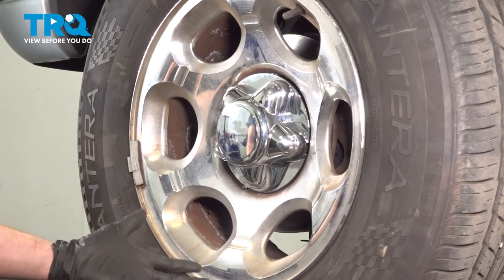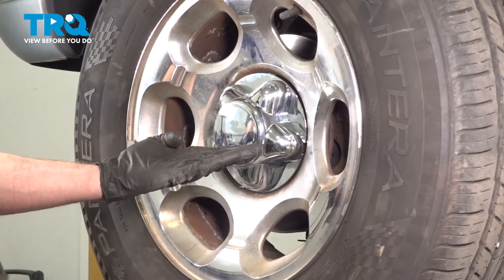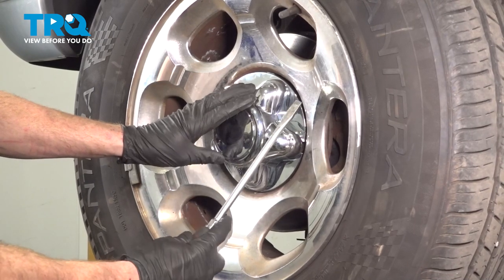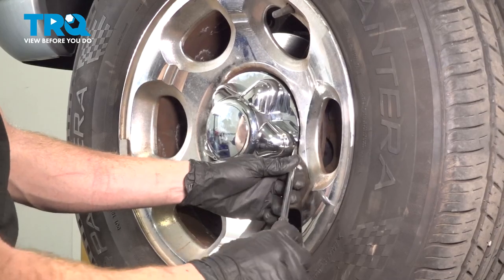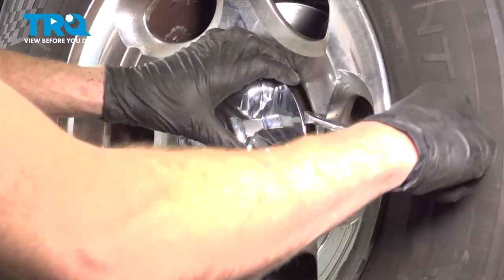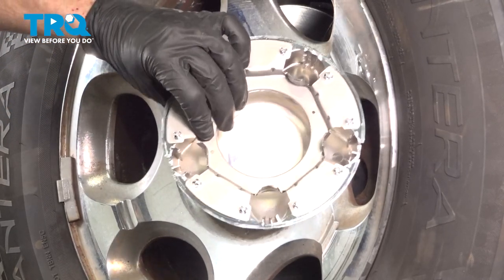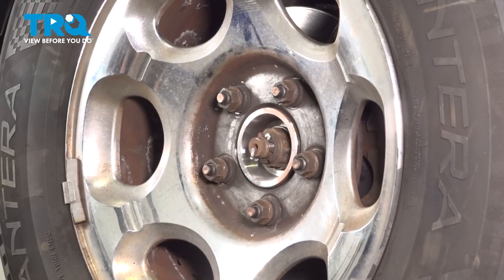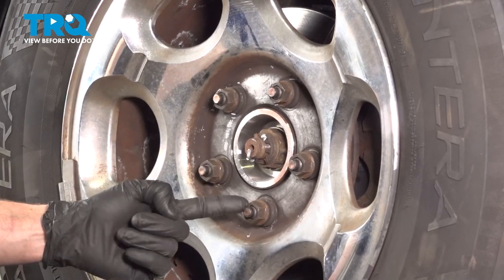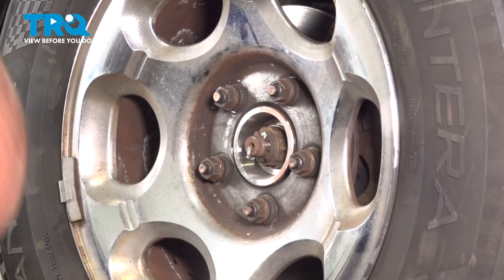The next thing you'll want to do is safely raise and support the front of your vehicle so we can remove the left front wheel. If you have a center cover, you can use a small prying device, carefully get in between this area and separate it. With that out of the way, continue on to your 5 21mm lug nuts and then remove the wheel.